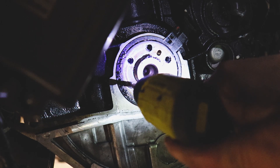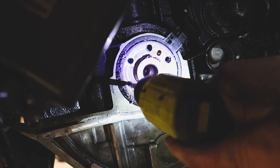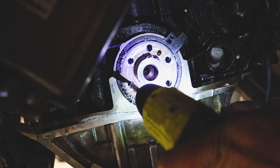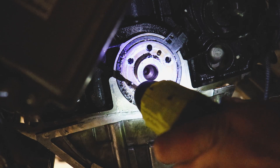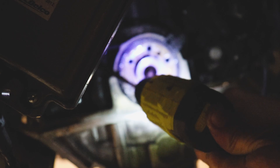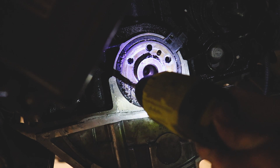I'm not using a ton of pressure, just enough to let it cut, not super fast RPMs. I'll toss a little more cutting lube on. We'll just keep drilling until we bottom that tape out. After all, we still do have to go up one more size. I'll tell you my plan for getting everything lined up and as straight as possible. I can feel as I get to the end of what's left of this bolt because it'll just really want to grab and pull that junk out.